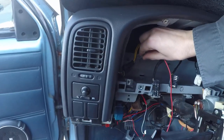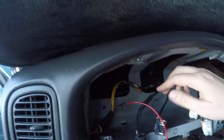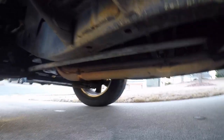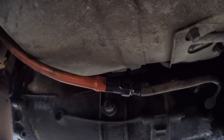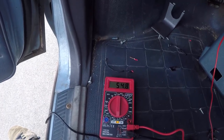I refer to them as back probes because they plug into the back of the connector so we don't mess up the front. Needles work quite well for sliding in between. I'm going to clamp on to the back of that T-pin. Both are yellow because I'm dumb like that, but we'll try them on the end of the transmission. There's the exhaust right there, sway bar torsion bars, and that little orange wire is the split on the wire that plugs into the transmission right back there. Going to undo that joint and test it. Got some kind of continuity — the jumping around is probably the T-pins. That wire should be good.